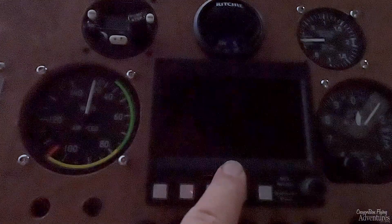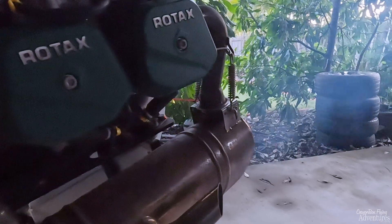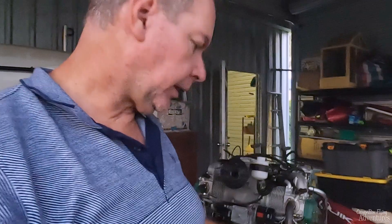Exhaust is good. I'm shutting it down. That's oil - it's cooking oil in the muffler. I might have to clean out the muffler. It seemed to get worse as it warmed up. I think there's oil in the muffler - but why? The EGTs and CHTs looked right, so we'll have to remove the mufflers, clean them out, and make sure they're both clean.